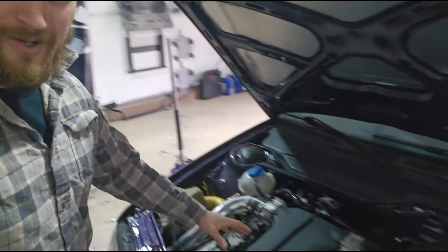Going over some of the footage — this thing smokes like a pig on wide open throttle, and I think I know the issue. I never really installed proper oil restrictors on the turbos, so I think it's just dumping more oil than it needs to, and that's getting sucked into the intake system. I don't really know how this stuff works, I just kind of know how to weld. I'm going to try some restrictors and go from there.